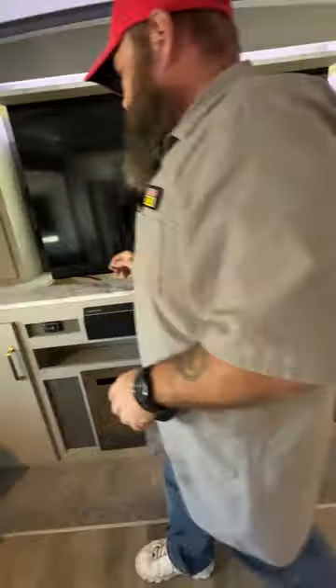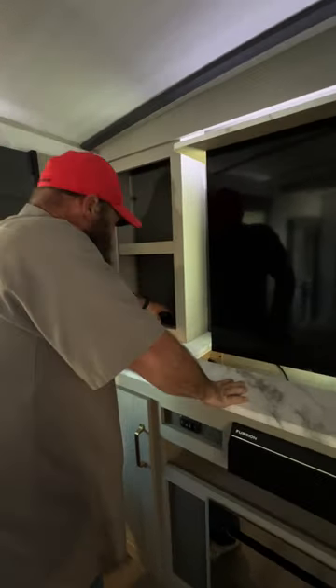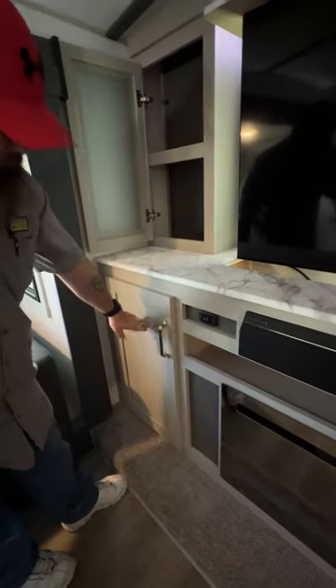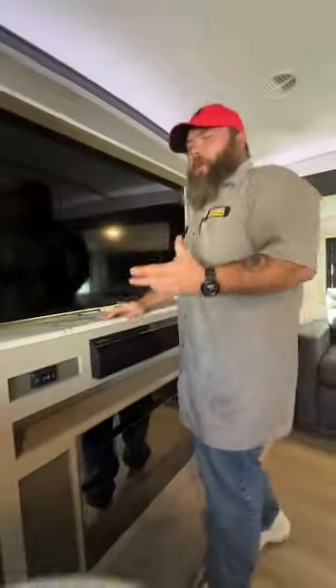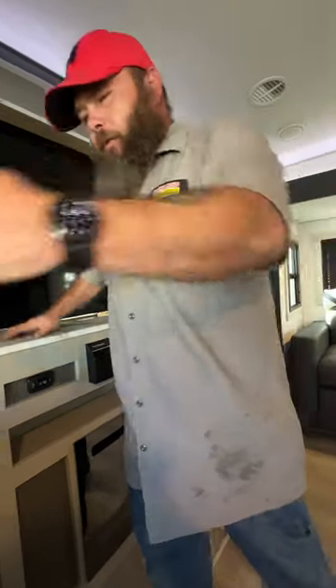For now the remotes are being stored in this cabinet. Once the DVD player comes in, it'll be installed down below as well. Down in that area is also where the TV antenna booster is located. At your water station outside, you've got a cable and satellite hookup — satellite uses the top port. If you're connected to campground cable, you have to turn the TV antenna booster off for that cable signal to come through. Just push the button — the light goes off — then scan for cable channels and change your TV settings from antenna to cable.